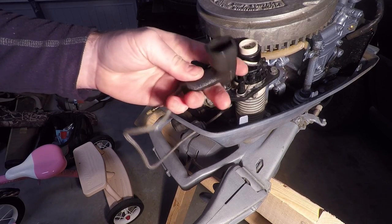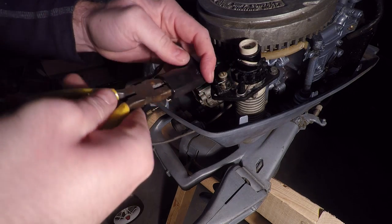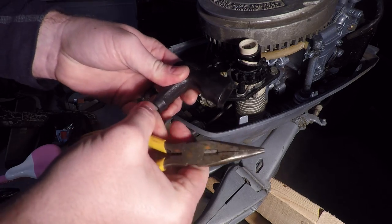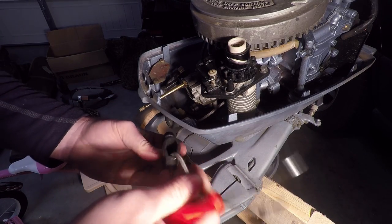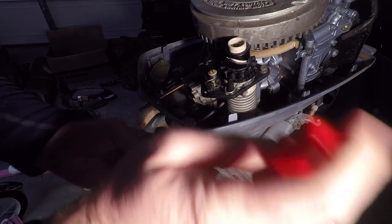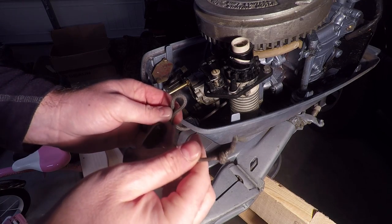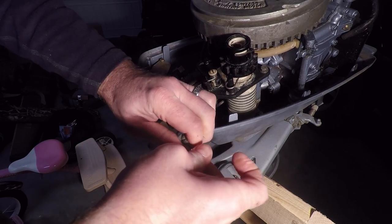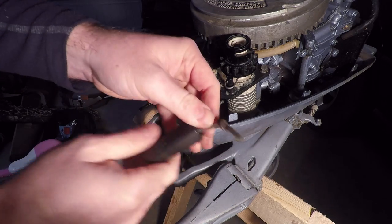You can see the starter handle is hollow on one end. If you take a pair of needle nose pliers, you may be able to reach down in there and get the end that has the knot in it. A pair of needle nose may not be enough to get down inside the handle, so I used a pick from a pick set to dig down in there and remove the end of the rope. Once you have the end of the rope out sufficient enough to untie the knot, you can get a little more slack. Tie a slip knot right behind the handle, and now you're able to remove the knot and then remove the handle.